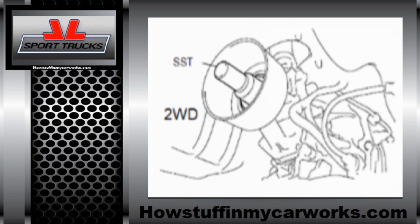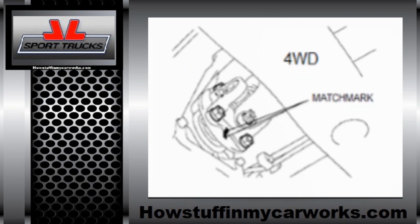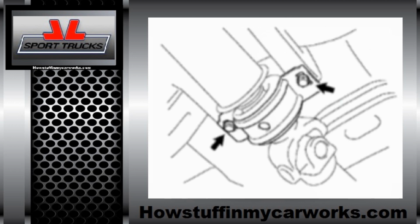On 2-wheel drive models, remove the extension housing plug from the transmission, coat the lip of the seal with transmission fluid, and slide the drive shaft back in. On 4-wheel drive models, align the marks and install the 4 nuts and washers and leave them finger tight. Next, install the carrier bearing bolts and nuts, but leave them finger tight for now.